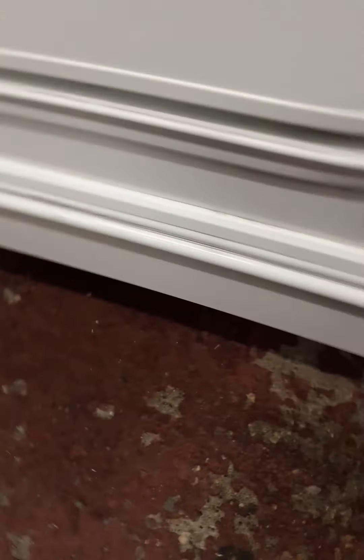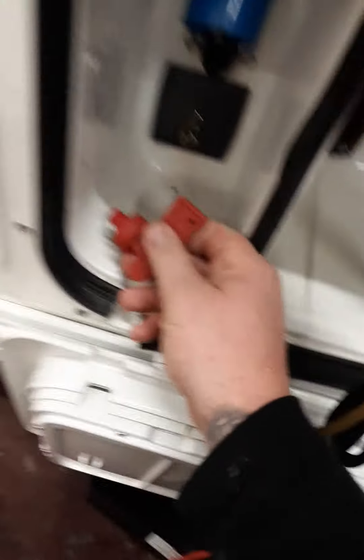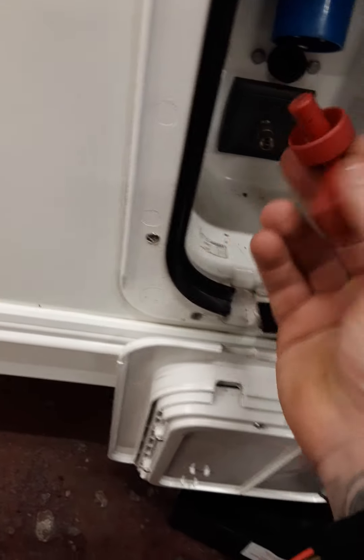On the mover, the van has a Power Touch manual mover. You put your bar on, engage it onto the wheel until you hear a clunk — this should do both sides as it has a bar across. Once engaged, hold both green buttons to turn the mover on. Then turn on your isolation key — put it in, turn it clockwise. Once it's engaged you can release the handbrake.